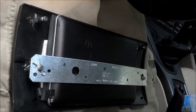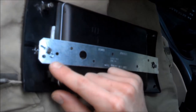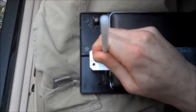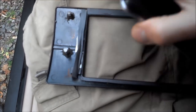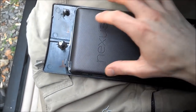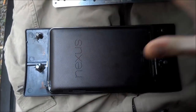You can see how the Nexus is mounted — this is a double din kit where I've sleeved the PEMs that originally came with it, allowing me to add a bracket secured with a cotter pin system. I pop out one of the pins, move the bracket aside, and can remove the tablet — it's protected so I'm not scuffing the rear of the Nexus. I can remove it and bring it inside in less than a minute. It just kind of falls back into place; I've got a temporary seal on it right now to protect the face. That's pretty much it.